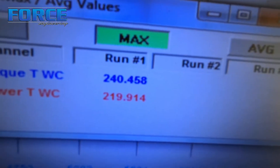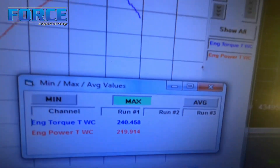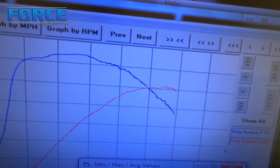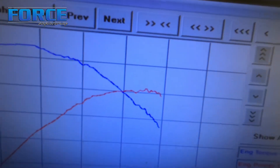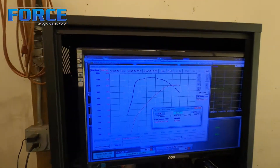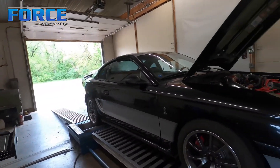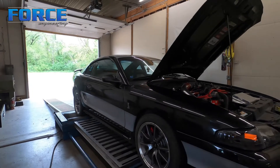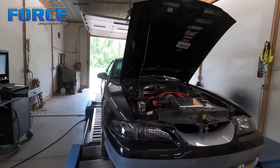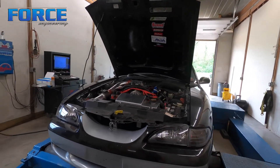Just getting wrapped up with this thing. Made 220 horsepower, 240 foot-pounds of torque. The torque number is decent even with that intake manifold on it. I was running up to 5,600 — you can see it's just over base peak power, right around 55. So yeah, 220 horse, a little bit shy of his goal, but as I stated, I'm not really surprised being a non-PI-headed stock camshaft two-valve. Even the PI-headed stock cam ones typically make in the two-teens to 220 area. So for a non-PI-headed deal, it did okay.